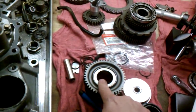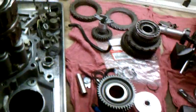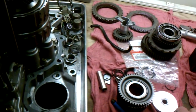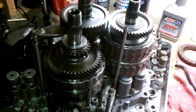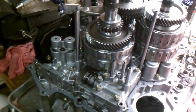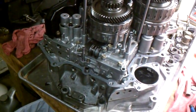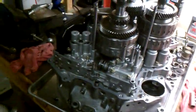So if you decide to tackle one of these, get yourself a kit with steels, get a new torque converter, and if you have to order a gear it's not that bad — HondaAutomotiveParts.com, the gear was $80 and the bearing it mates with was about $20. I'm thinking I've got roughly $500 into the rebuild of this transmission versus spending two to three grand at a shop. It was easier to pull than my EF '91 Civic transmission, which I've done before. This is my first automatic — simple, piece of cake. Don't be afraid of it.